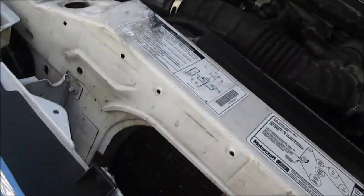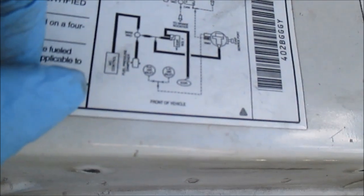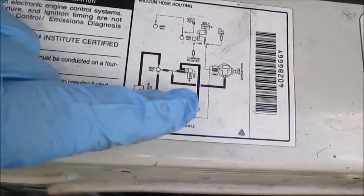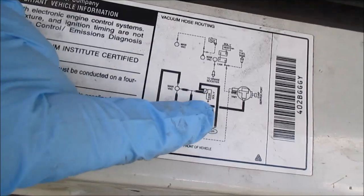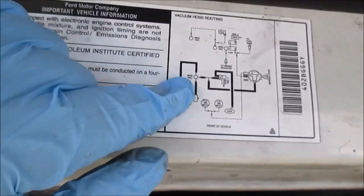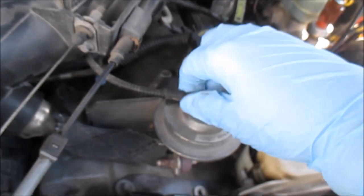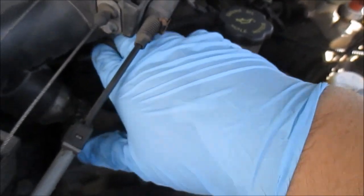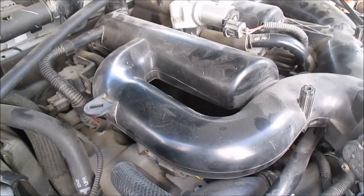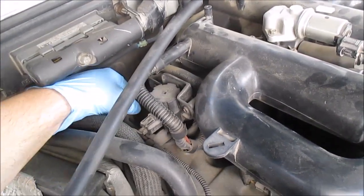If you look here, this can help you out a little bit — there's a vacuum lines diagram. There's some EVAP stuff, vacuum controlled, EGR solenoids with vacuum lines going to them. This can point you in the right direction looking for leaks. Check all these fittings and find them on here. See if anything sticks out, like a broken hose.